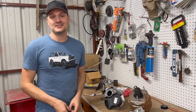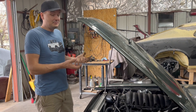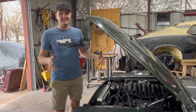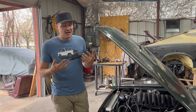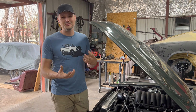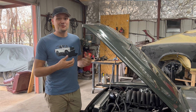The booster is now installed in the car. It's time for a test — just a driveway test. The pedal feels good. The bore size on this master cylinder is 15/16, which is super close to what I need for an all-wheel disc brake setup. I'm going to add a remote reservoir to the system — you can move that reservoir around, which makes it really convenient for a setup like mine.